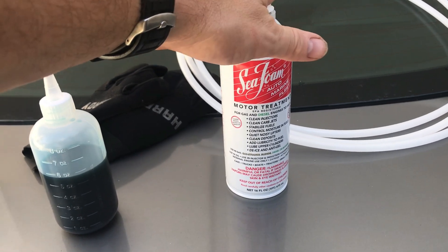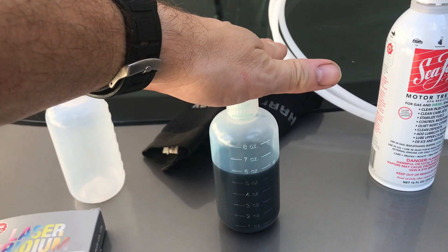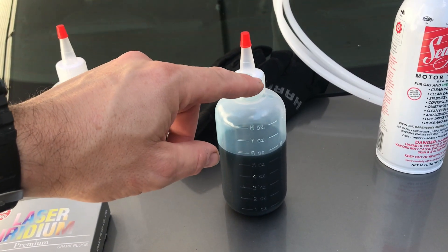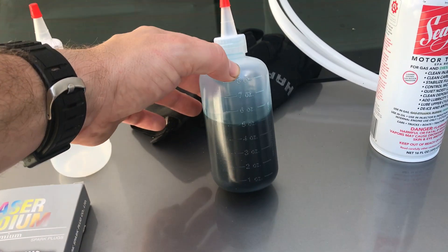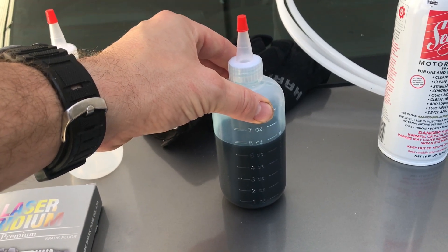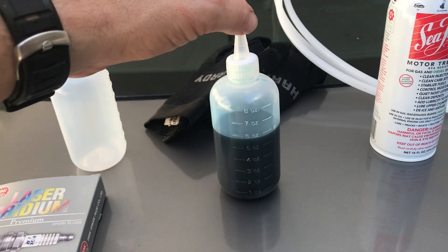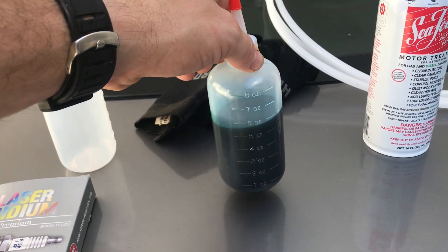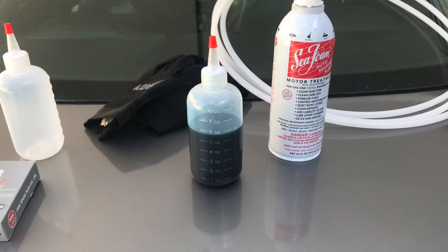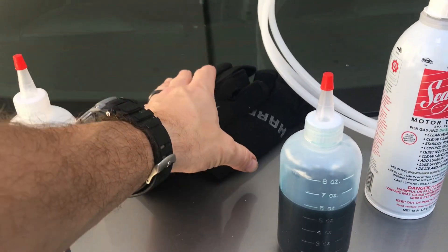The second thing is pre-mixing. If you're not sure what pre-mixing is, I did a video summarizing it. I'm going to basically double my normal pre-mix. I put about three-quarters of a tank of fuel in and added six ounces of pre-mix — I typically use four ounces for a full tank. The reason we're adding extra pre-mix is that by decarbing with Seafoam we're going to dry out our apex seals a little, so you want extra lubrication for them.